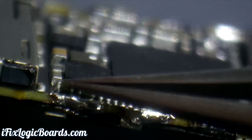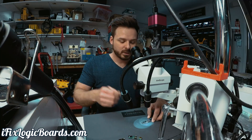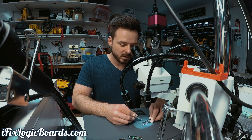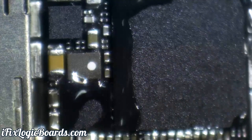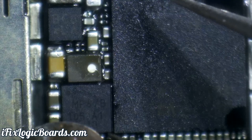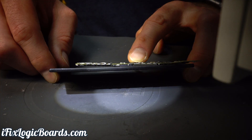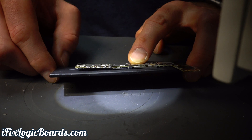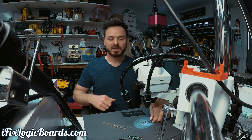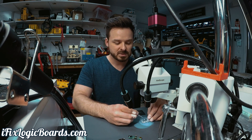I still looked at the bend there and you can see that this chip here and the baseband are kind of on that curve. So what I decided to do is just give a quick reflow of the chips and the baseband. I poked it a little bit just to be sure that it really melted, so it possibly reconnected with the pads that were lifted or just cracked from that bend. After that the phone booted up and I was able to do the backup — happy customer.